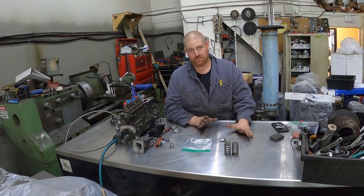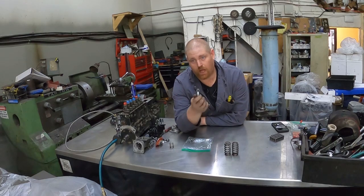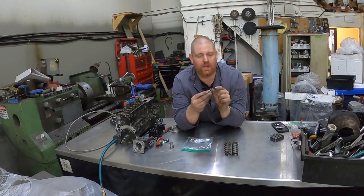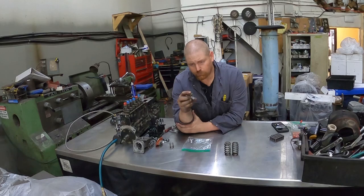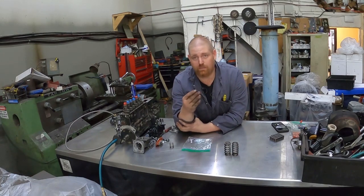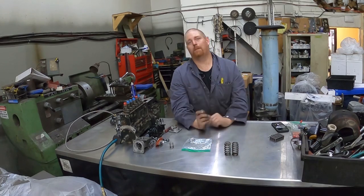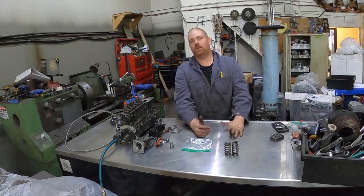After that, you can add a little more fuel to the system. I recommend doing an overflow valve upgrade — I'll put a link in the description. If your overflow valve has a bolt on the end, you can spread the spring to increase fuel pressure, or buy an adjustable one from Torque Technologies. You want to get your fuel pressure as high as possible — 30 to 35 PSI or more is reasonable, regardless of whether you have the 160 or 170 horsepower pump. More pressure is better.